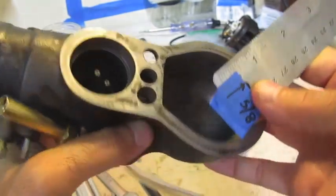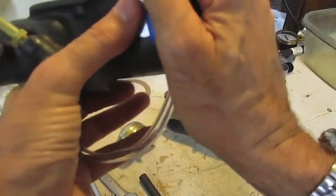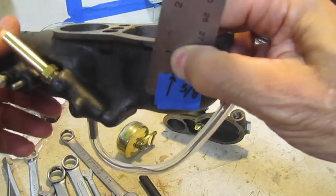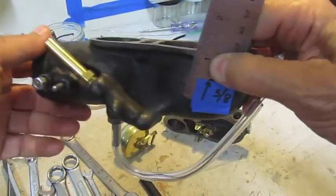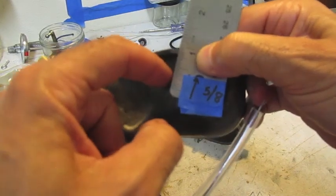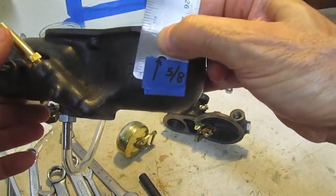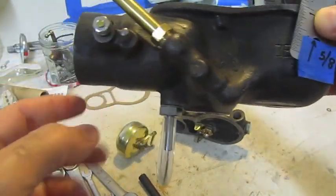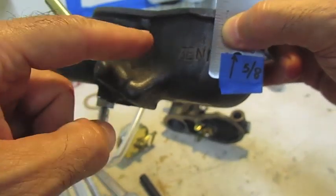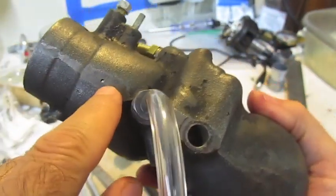The gas in this bowl — if it's too high — can potentially cause problems. For example, if you stop real fast in your Model A and the engine just dies, you may have flooded it. That can happen if your float level is not correct, letting too much fuel in. Too much gas in your bowl over that five-eighths limit means it's sloshing around too much. You may also get a drip in the back.